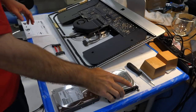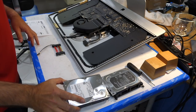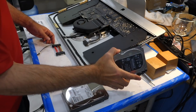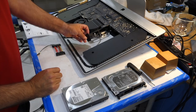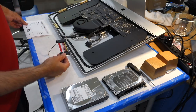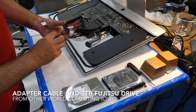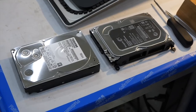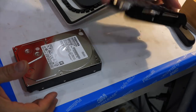You'd think you could just replace a SATA disk with another SATA disk of the same RPM and transfer speed — but no! That would be too easy, because Apple has put another obstacle in their way. They modify the firmware of the disk so it can read the temperature and report it through the SATA interface. So I had to buy a special adapter — the disk came from Otherworld Computing; I've bought from them before, they're good Mac suppliers. And when the Mac is on, you can't hear the disk at all — you'd think it's an SSD even if it's a normal disk.